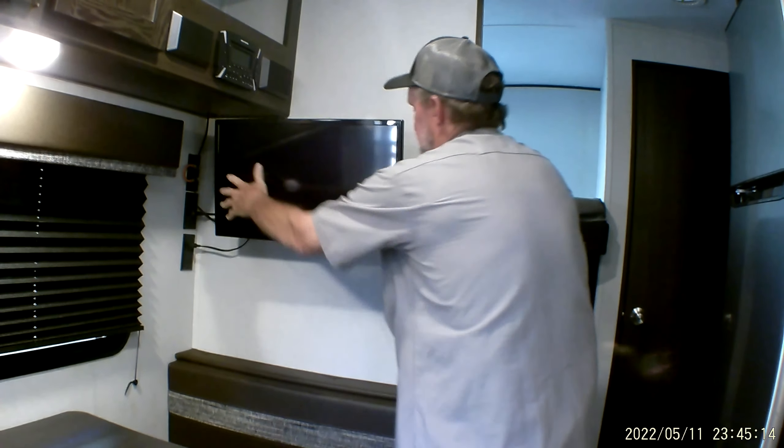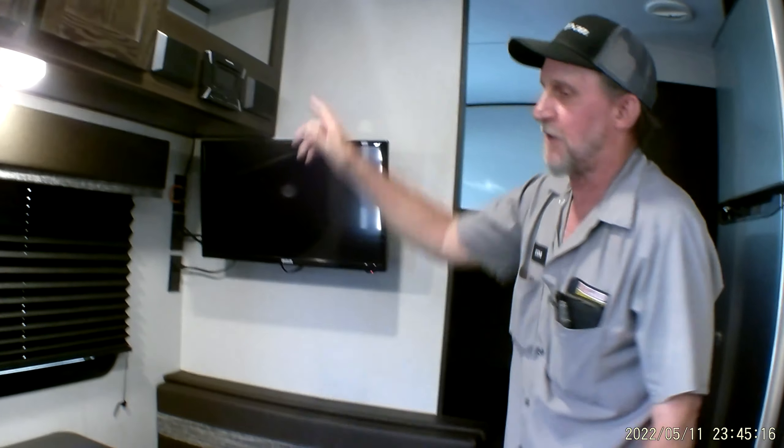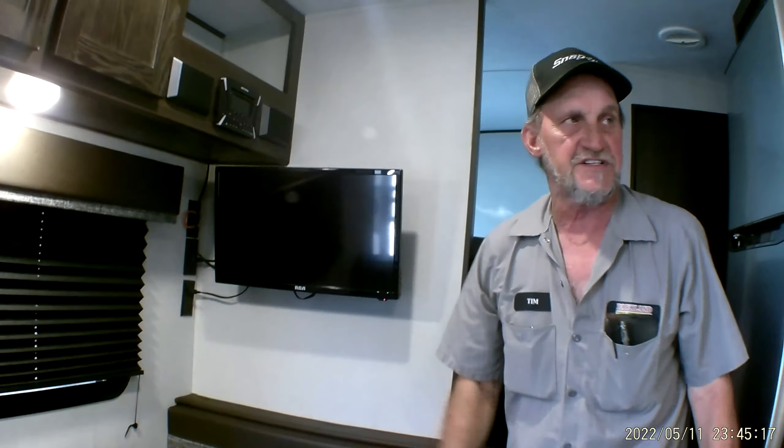The TV will just fold back out of its way. There is a little remote for the stereo at the top. It has an on/off button and A and B speakers — A is your inside speakers, B is your outside speakers. It will also play a DVD or CD through the stereo. For a DVD in the stereo, you have to change your input setting on the TV to AV1. Then you can do the speakers inside and out.